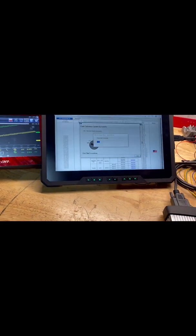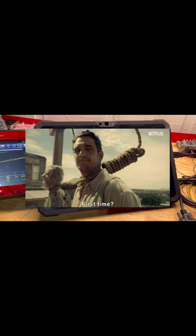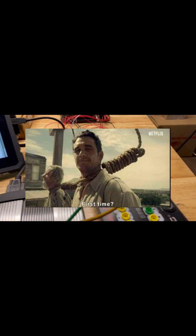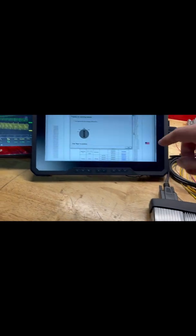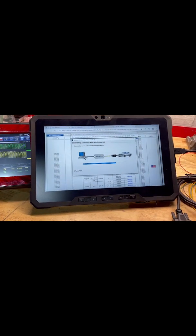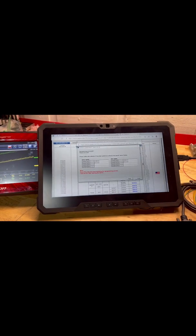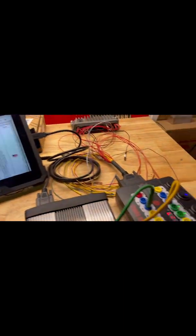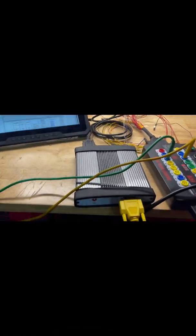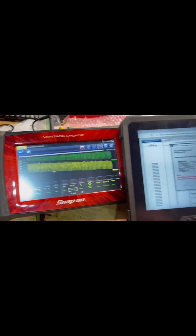Click Next. It never does that by the way — going to that whole screen that says Finish. I've never seen that, unless it's a new thing with the update I did this morning. Next is power on — give it a second — and boom, successfully programmed! Bench flashing with the CarDAQ using factory software, with some really bizarre-looking CAN waveforms, but who cares — it works!